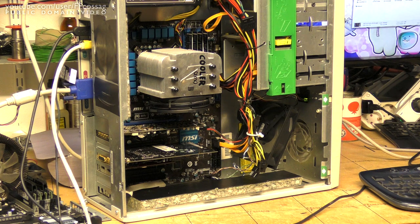With the graphics card gone, we've dropped our idle power consumption down to 45 watts, which, while not really super good, is 15 watts better than 60. And I just did a bit of testing, and I can still encode video just fine. If we enable Intel Quick Sync, then I can pretty much render at a much higher quality standard than I ever could on the AMD machine while not really using the CPU for anything.